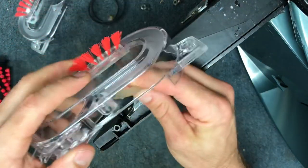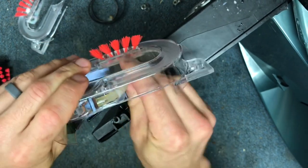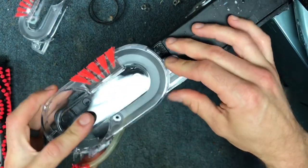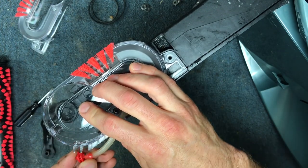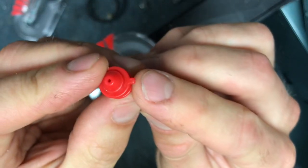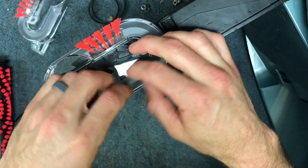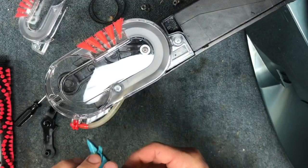Actually, we're going to go ahead and install this other end piece. Again, if you have the spot shot, you may have left this connected — it probably would have been easier if you're planning on cleaning it to just take it off completely. So in my case, I did take it off, and we're going to attach that spot shot piece back in and install it in place. The spot shot little shooter has a little locator tab right there — see the little piece sticking out here that locates at the very bottom just so it doesn't twist. Then you have the long screw that goes in right here and the short screw that goes in here.